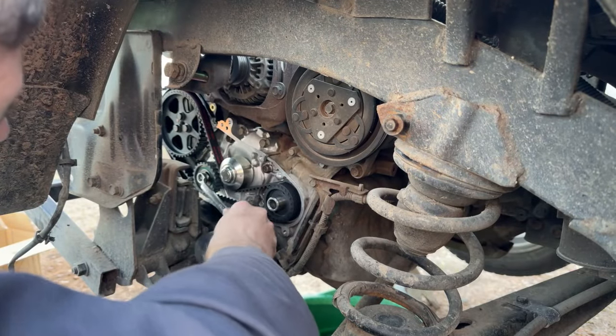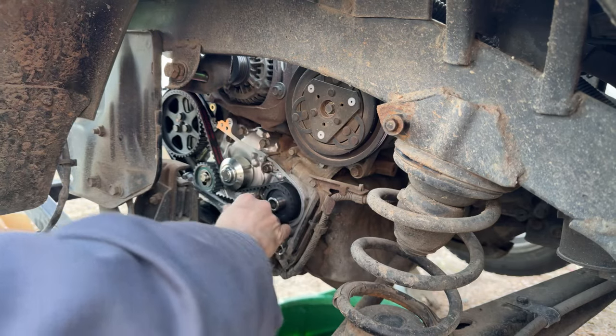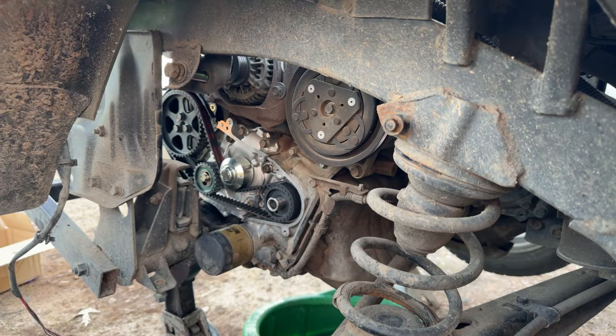Sent you down. And look at our torque specs for you again. And we're good to go on this timing belt install. Other than that, we got to clean up our timing covers, do something with that timing cover seal that is askew, put our dipstick back in there, and thermostat, coolant, and we're good.